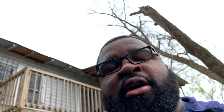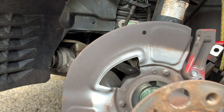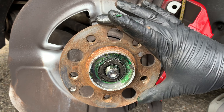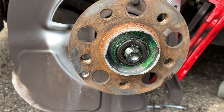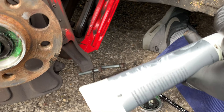We got it off finally. If you find yourself battling this like I did, here's a tip — I didn't have a rubber mallet, and I should have had one. First remove the caliper by loosening the two bolts top and bottom, then move the pins out of the caliper to make it easier to wiggle and slide it off the rotor. Use a bungee cord to hang it. The rotor sits on top of the bearing — remove it with a T30 star bit. You may need to beat the rotor to separate it from the hub. Without a rubber mallet, I removed the lock nut with a wrench, slid the whole hub and rotor assembly out in one piece, put a cloth on top, and beat the hub out with a hammer.